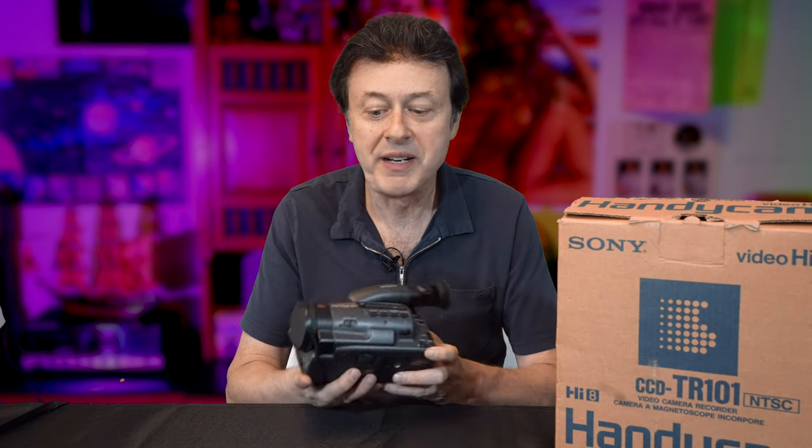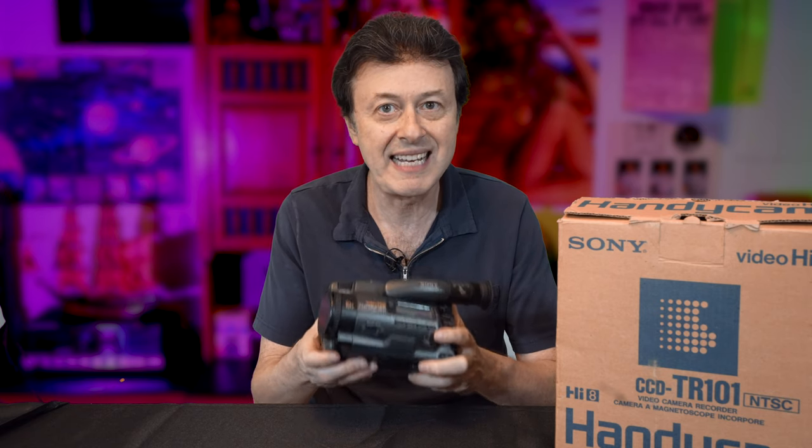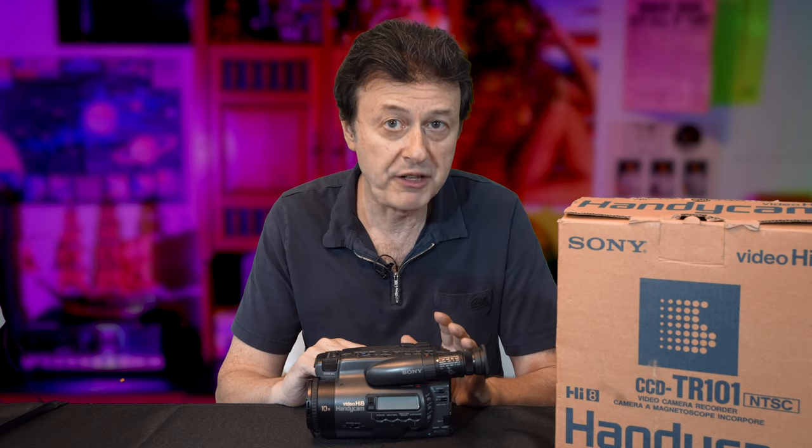In conclusion, I would consider this a real solid vintage cam — a famous cam in that it's the very first to have optical image stabilization without picture degradation. It's good looking, feels beefy in the hands, has a nice 10x zoom, and that vintage Hi8 picture quality look if that's what you're after. How easy is it to get? There's usually a fair amount of them on eBay, but finding one that is fully working is more difficult. Like so many Hi8 models from the early 90s, leaky caps is an issue with this camera. You have to get lucky and really question the seller. Watch my video about buying vintage camcorders on eBay. You can get them, you just have to be careful that they work. But it really is a nice cam and I do recommend it if you're a collector.